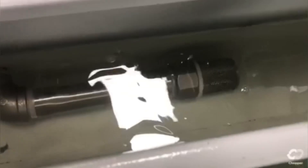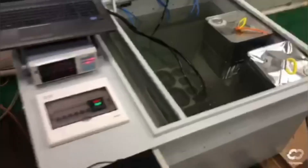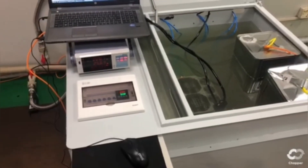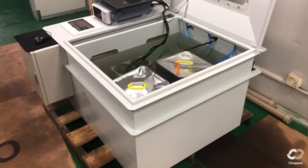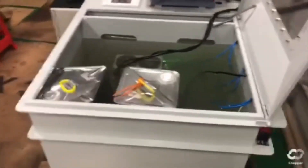The hot oil flows to the top and then goes outside. As you can see here, we have an oil port draining the hot oil. We circulate that through the heat exchanger and then push it back again to the tank. You can feed up to six S19 110 Tera hash units on this tank, but this company can make even larger units depending on customer requirements. Let me show you the back.